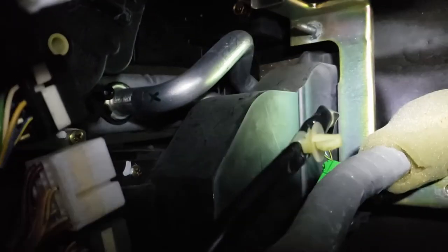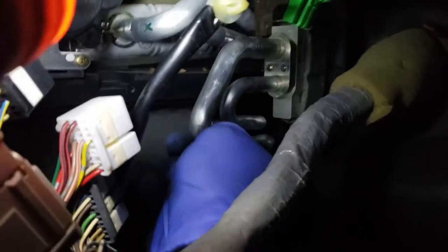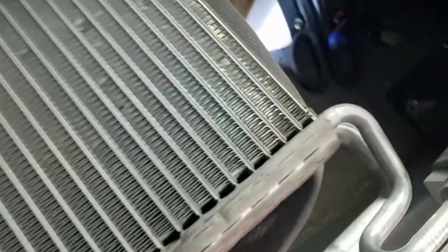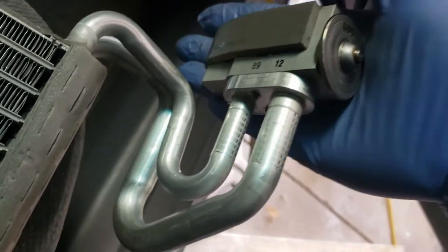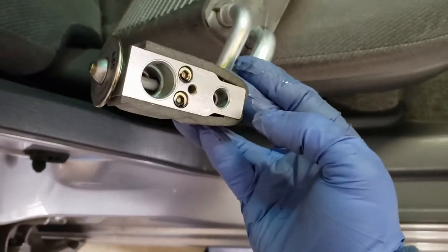This has a cabin air filter and I didn't know that — so that's kind of cool. Now you can see where the TXV valve is at the end at the right side of this aluminum hose. The TXV valve is there but this plastic piece here has to come out — I think that's just held in with screws. We'll slide out the evaporator and then the TXV is at the end of that. Just move the wires out of the way and then it'll slide right out. There it is — and here's our valve here.